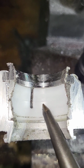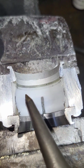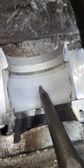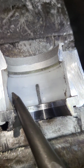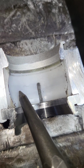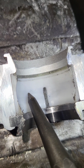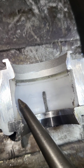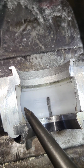And then that looks kind of normal. When you go over to this other half, it's not as defined. It's actually worn away. It's rubbed away. I don't know what this is made out of, Delrin or nylon, but it's completely worn out at less than 500 miles of use, which was creating some weird knocking and popping sounds coming from the front end of this vehicle. It was driving me crazy.